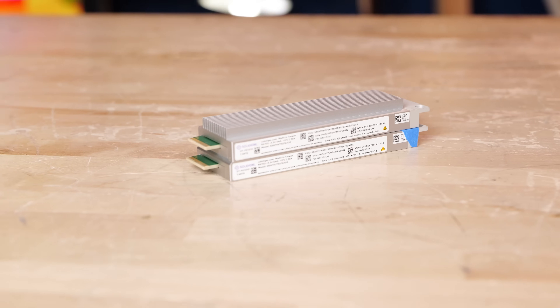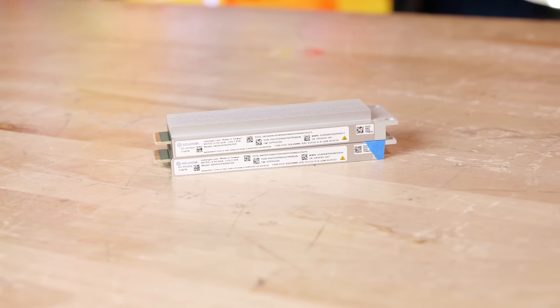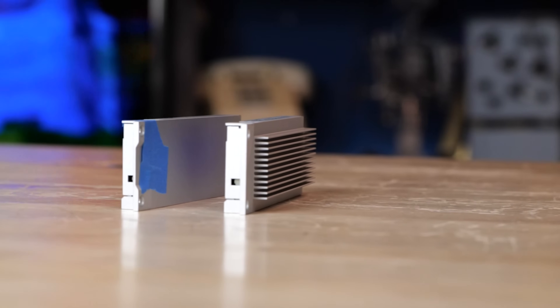What's happening under the hood to drive this kind of density is really interesting, because as density goes up, heat production and power budget tend to climb as well. We are working with 176-layer flash, and these are available up to 7.68 terabytes today. They're launching now, and one of the important architectural changes — which I think will trickle down to desktop users — is deliberate design choices to reduce latency.